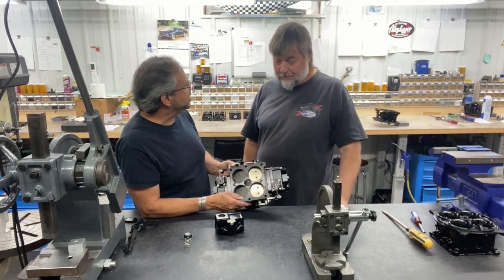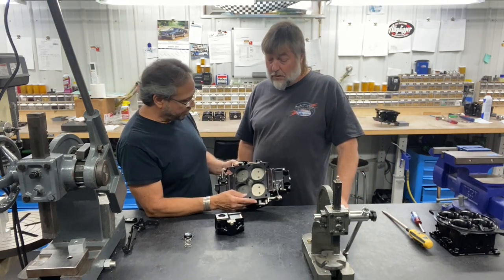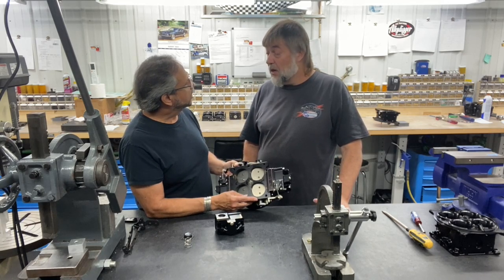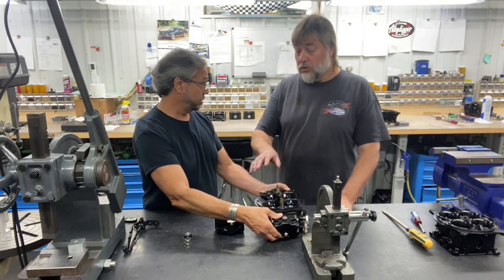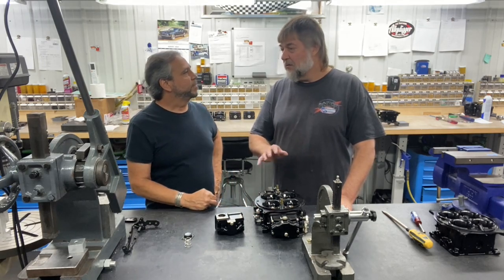This is the stuff people love to hear because it's real world experience and people don't talk about it. We do have the carburetor and it is functional — we're still working on some tuning. The amount of squirter change from here to the bottom is huge: up here you might need a 40 thousandths squirter, but when you put that to the bottom you need about a 15.